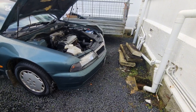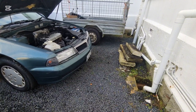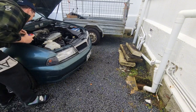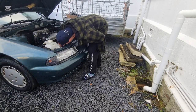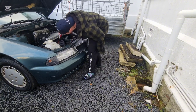Yeah, g'day. This is my Mitsubishi Magna 2.4 litre 4G64 starter motor repair, swap, replace, whatever you want video. I also am fixing a squeaky belt tensioner pulley because I couldn't find one, as you'll see later on. So right now I'm starting out with some WD-40, not spraying it on the belts, spraying it on the pulleys themselves to identify what one is squeaking.